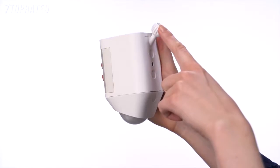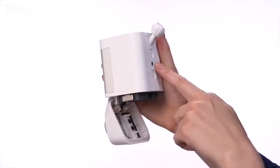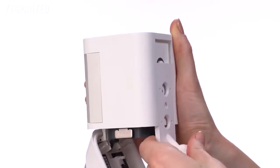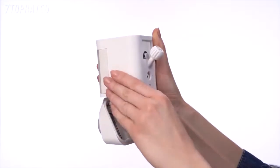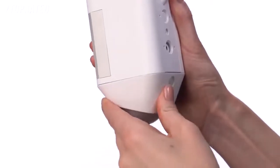To do this, first open the battery door by pressing the button on the back of it. Next, remove the security screw and the weather seal. Press the release button and slide the mounting plate out. To mount on a wall, insert the mounting plate with the ball socket pointing down. If you want to mount Spotlight Cam on an eave, insert the mounting plate with the ball socket pointing up. Firmly close the battery door until you hear a click.